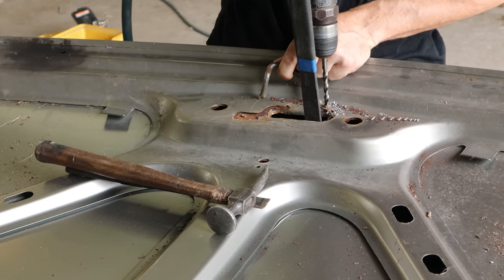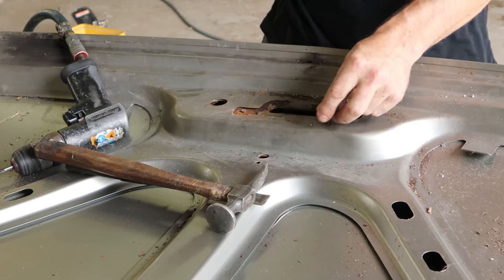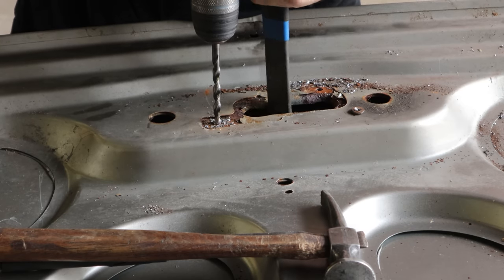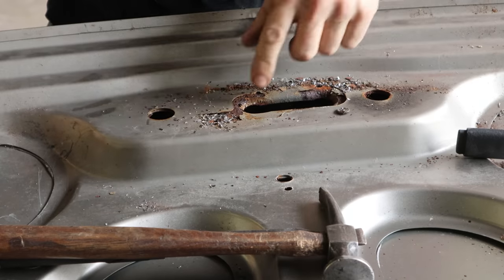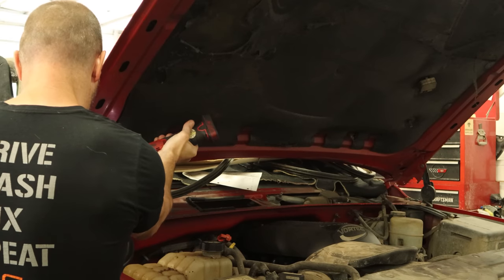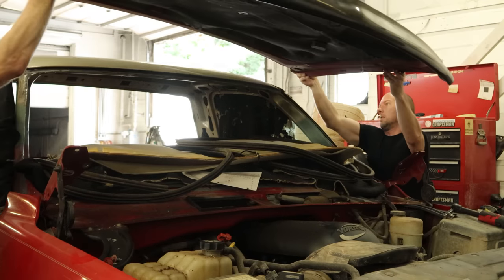It didn't matter because I didn't push it all the way through, so we're okay — bodywork gnome is still happy. The end of our rivet fell out of there. Now we can drill out the rest of the rivet on the side that we ground out, since that was a fail. Sometimes your first method isn't always your best — the drilling method was way better. Put our breaker in there so we don't end up with dents in the hood. This one's a little bit rusty around that latch — pretty common on these — but the rest of the hood was rust-free so the seams were all really nice. Let's clean up that rust around the latch. But first we need to get the hood off of our truck because we need to cut our latch off this one. So we unbolted our hood hinges, took our ground wire off, and our hood light. This truck is old — it has a hood light.